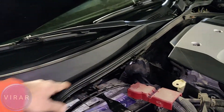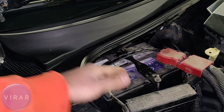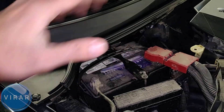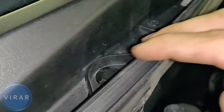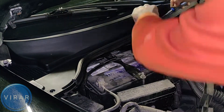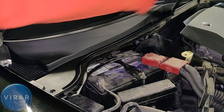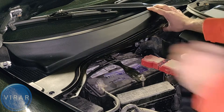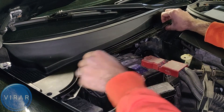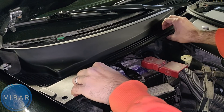At this point you may be tempted to just go ahead and start taking all the connectors off, but don't. We need to take off that other piece as well, because once that piece is off, you can easily get the battery out. There are two clips in total holding that other panel in place. Same process to take the clips out as the previous five. Once you do that, let's get that rubber strip off, then lift up the panel a little bit and pull it out towards you.